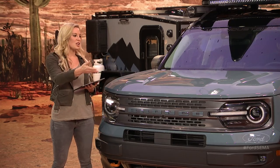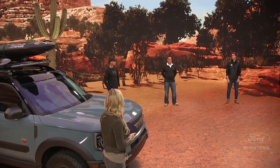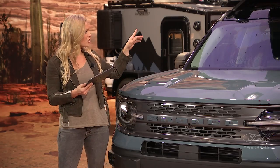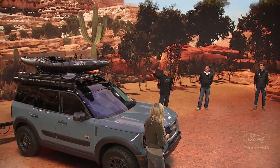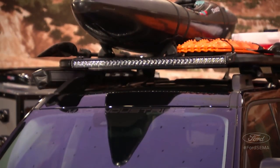What are your favorite components of this build? Personally, one of the most notable things in the interior is the carabiner hooks and the MOLLE strap systems in the back of the seats — if you're going out for a weekend adventure, there are truly a ton of places to put all your gear. How about the installation of the Rigid SRS light bar? The system with the Yakima Lock and Load and their lighten-up brackets is really straightforward — the main task is getting the wiring into the cab, but it's an hour project and you can do it at home.